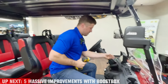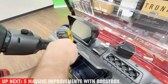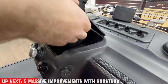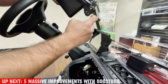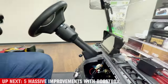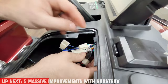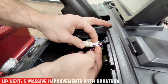Turn your cart off - it's always good first practice. You have two screws right here inside of the dash - remove those. Put the screws back in so they don't fall out. Pull this up at an angle to get it out - you sometimes have to go pretty far because this has an arch on it. You have to have it at an angle like that to put it back in too. Once you pull that out, there is one 4-pin connector. Unplug those from each other. The 6-pin connector you want has labels on it that say 91, 92, 93, 94, labeled A and labeled B - unplug those from each other.